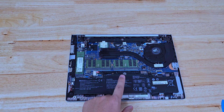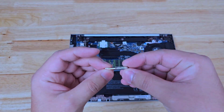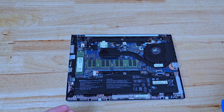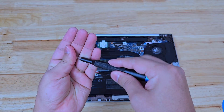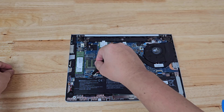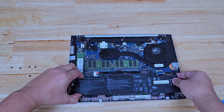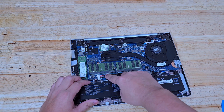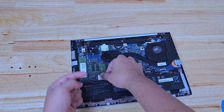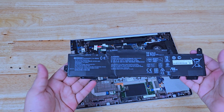For me, I'm actually here for the battery, so I'm going to go ahead and take this battery off. To take the battery off, we are going to need a Torx T9H from our iFixit kit. We'll switch to that and take out these screws — one, two, three, four, and five. To get this out, we're just going to simply lift, slide forward, grip under the cables and then pull to the right. And that should come right off — and there's the battery.